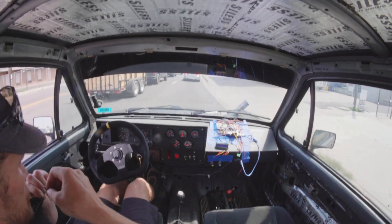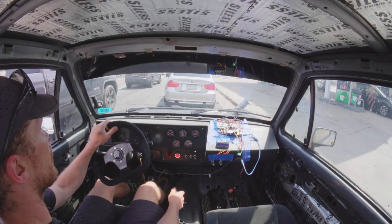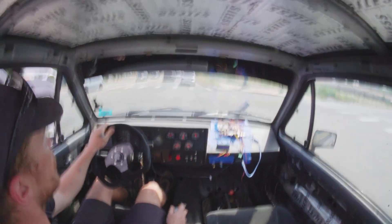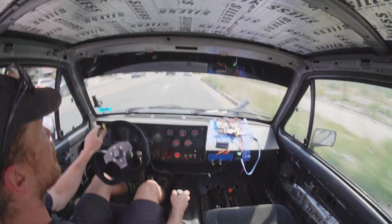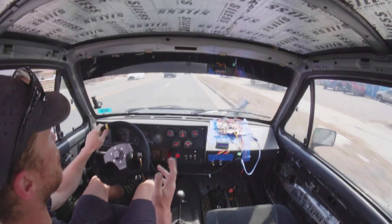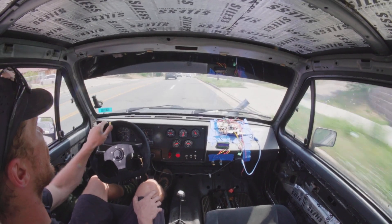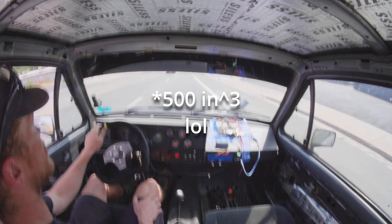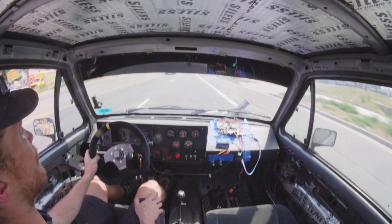Just as a reminder, we're still breaking this thing in — we've got 20 miles on it, 20 miles on the recently rebuilt motor. So for initial settings I've got 20 pounds of boost and 20 pounds of drive pressure. Some people have this theory that you're supposed to baby an engine when you rebuild it, and I don't believe in that. You never see it — no one's out there in an 800 or 1,000 cubic inch blown V8 in a dragster putting it around breaking it in. They run that thing down the strip once and rebuild it.